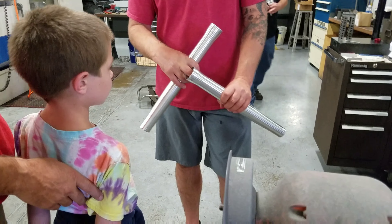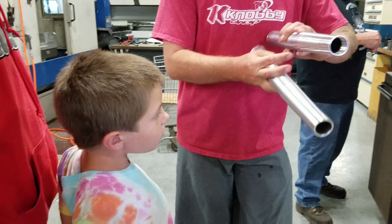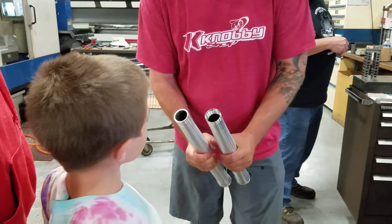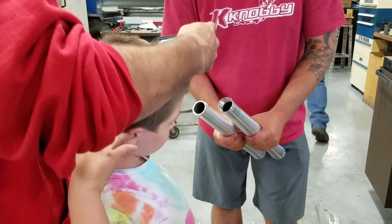It's in that machine that comes in here and puts all these. This is where your seal is, your bushing. And then on this side, same thing — it's got a seal and some threads that go in there. That's where your fork bottom plug goes.